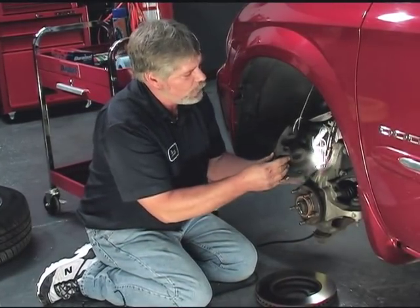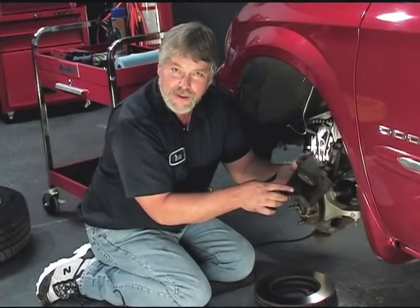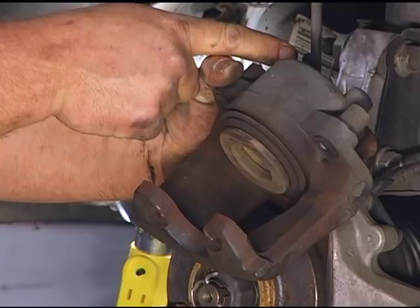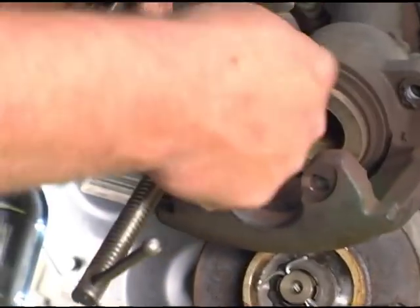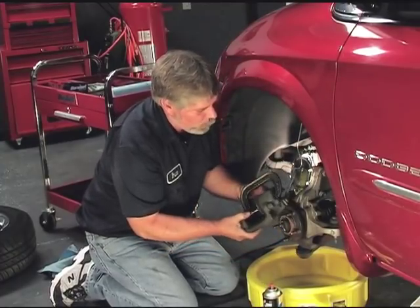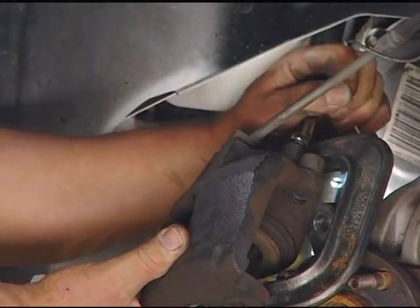On the caliper, let's go ahead and unhook it now — just leave our hanger handy because we might be putting it right back up on there. There's the piston; this actually applies against the inboard pad. Before we put the new pads and new rotors on, we need to push the piston back into its bore, and there's a trick about that. What we want to do when we push the piston back in is expel the old fluid right from the bleeder screw. We use a c-clamp, put the threaded end right into the hole of the caliper piston and get it set. You don't want to tighten it right now — just get it set into place with a little bit of pressure. Now at this point, go ahead and open up the bleeder screw. You don't want to open the bleeder screw until the c-clamp is in place, or you could have air enter into the system.